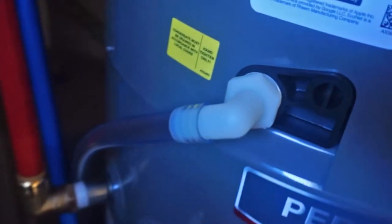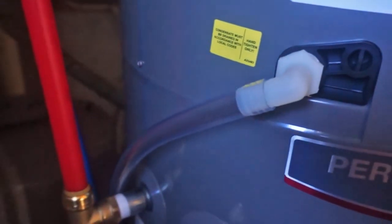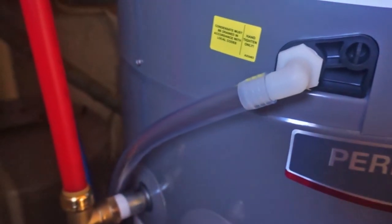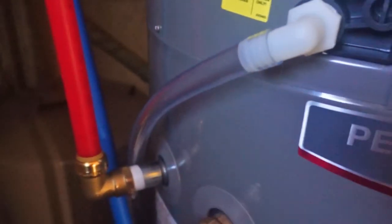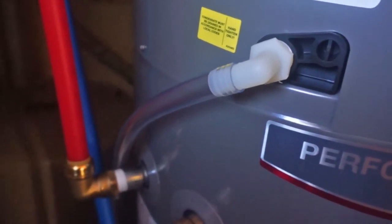I will show the app on that in a minute, but this is the outlet where the cold air blows out, so it's like an air conditioner. But on the top right here is where the air goes in, and it dehumidifies the air, and the moisture from the dehumidifier goes out right here. I don't have this completely set up right yet — I need to have a trap in that so that it dumps into my septic system so I don't have to carry the water out all the time. It's taking about a gallon of water or more a day out.